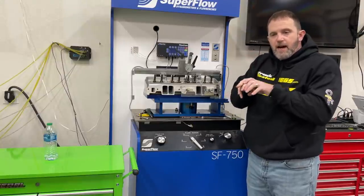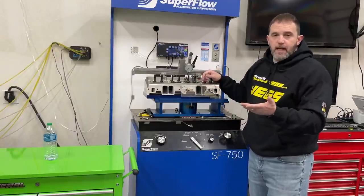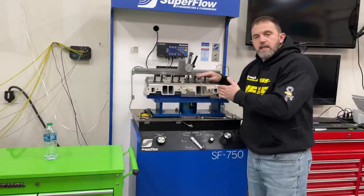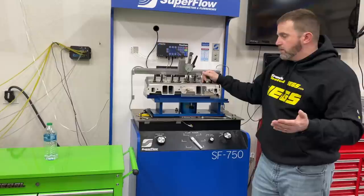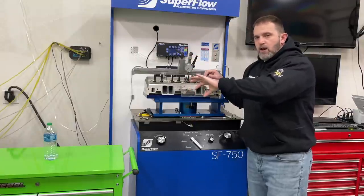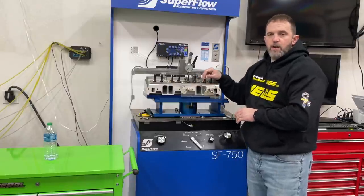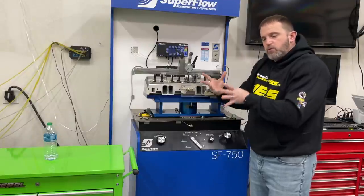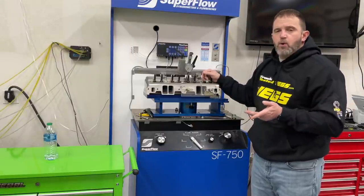The idea is to keep it re-atomized with swirl. If you're on injection, it's spraying a mist. There's a reason why they usually have the injector pointed at the back of the valve — it's spraying fuel, and while it might be a mist, it is not a vapor like would come out of a carb. The reason they spray at the back of the valve is that it's the spot with the most velocity, and if you spray it there, once it hits that higher velocity, it should atomize it. If you look at the LS head, it kind of shows that — it sprays at the back of the valve, gets atomized, and doesn't need as much swirl. That's why those don't really have much swirl. For a carb setup — say a single plane — it left atomized, hits the floor, loses some, makes another turn, comes out of suspension, makes more turns, goes into the port. The swirl kind of helps re-atomize it. That's not to say fuel injection stuff wouldn't respond to more swirl as well.